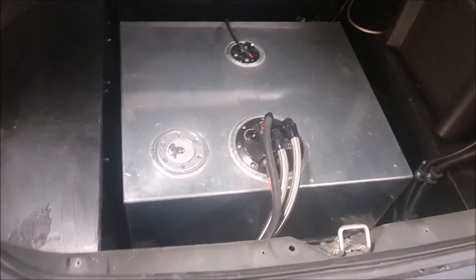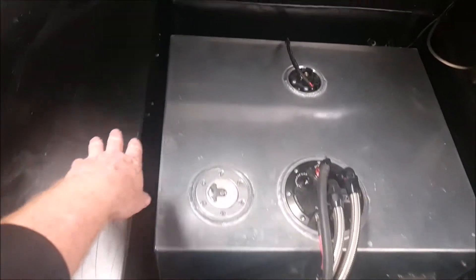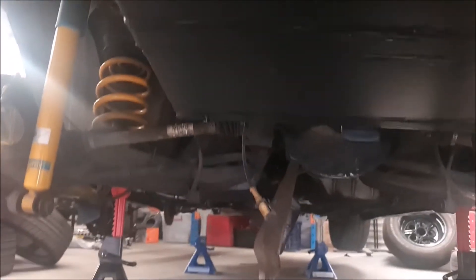We finally got the fuel cell in. We've cut a hole in the wheel well like we said, welded a frame in the bottom, welded up all the edges and sealed it. We've also put Raptor on the bottom. That looks a bit better.